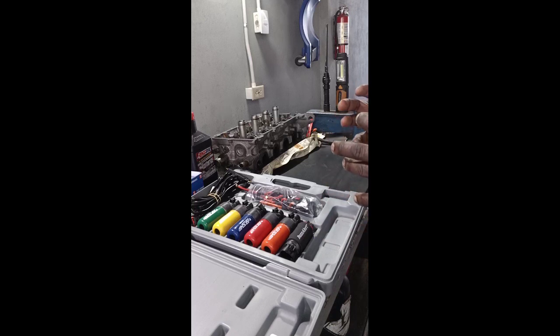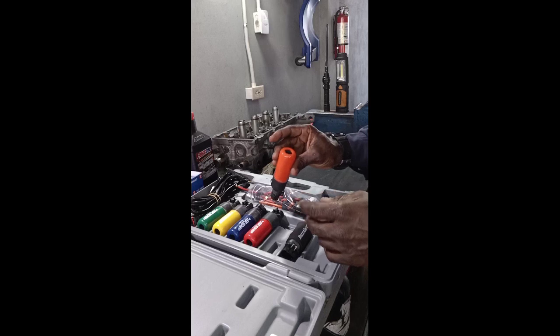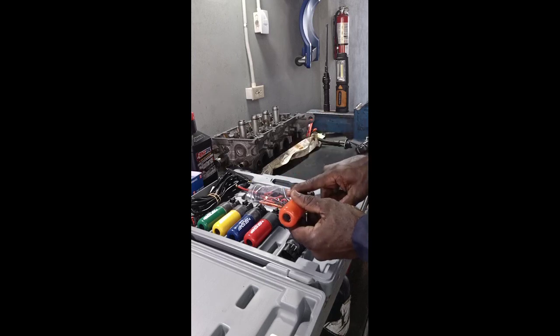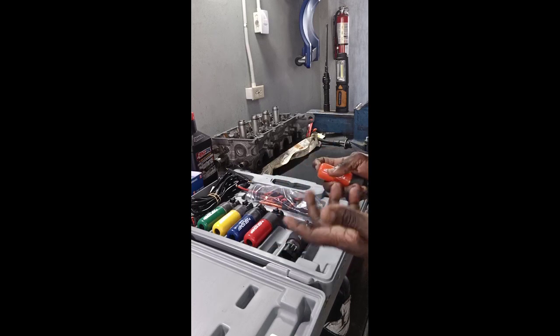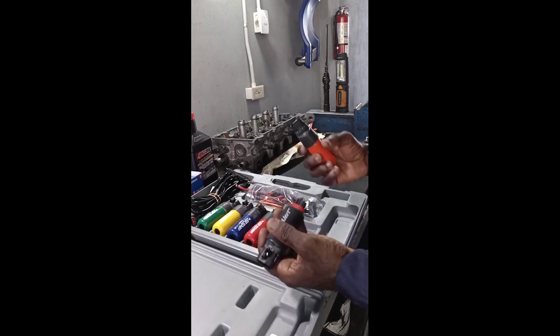This is really handy when you have a fault where you put the fuse in and it pops automatically. The fuse saver takes the damage instead of you always replacing the fuse. It has a breaker built in, so as soon as the inrush current exceeds the rated amp, it will trip. You have to come back and reset it, but you need to leave it a little while to cool down before you can reset the breaker.